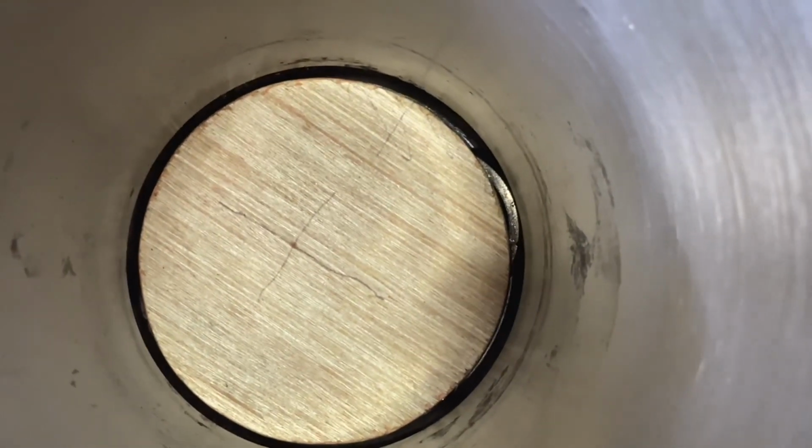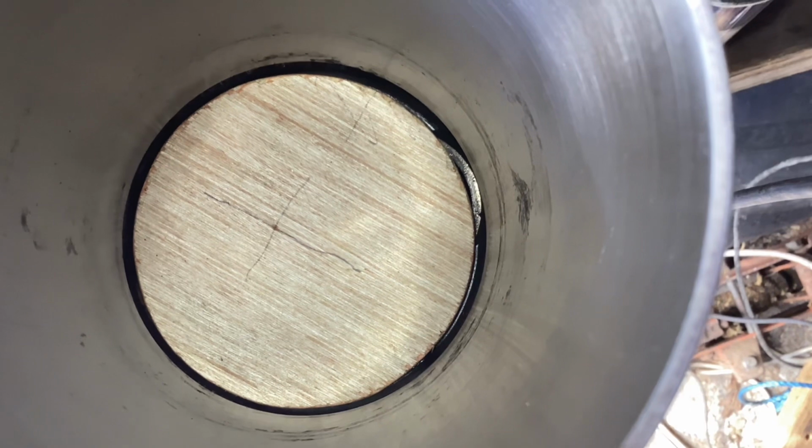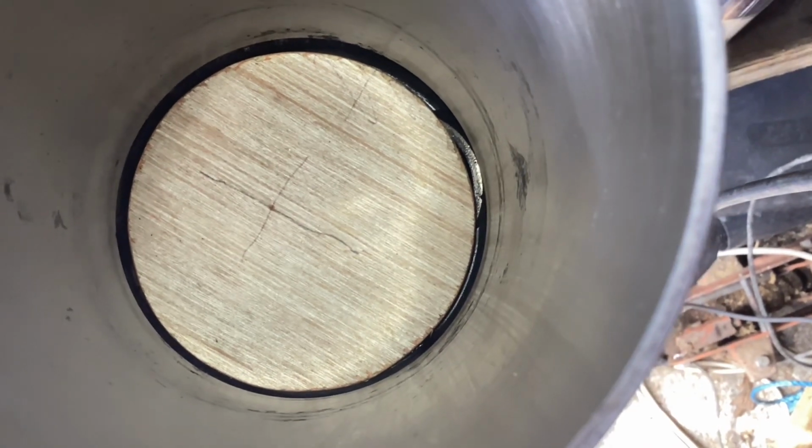Please excuse the wobble vision, but I wanted to show you the cylinders now they've been honed. See if this thing will focus reasonably well. There you can see there's very little wear. The thing had only done 107 hours from new, but I think it must have seized up during its storage. It's no great surprise. I think when this last ran in August 1939, there were bigger issues concerning the Austrian corporal than the preservation of fairly useless two-cylinder aeroplane engines. So it must have seized up at some point.